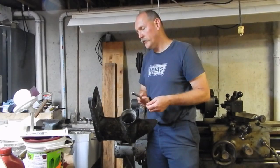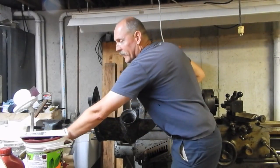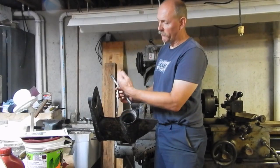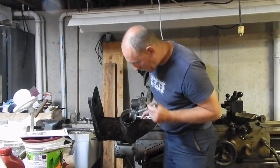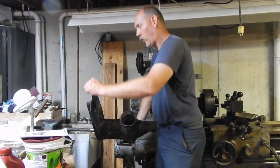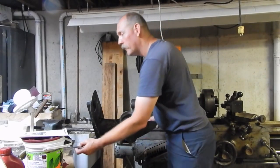This is the procedure he's used. I bolted the vise down securely, and I've got the shaft clamped in the vise there. Then he uses a box end wrench, and I was having trouble with the box end wrench slipping off. I think if I had a box end wrench that was straight instead of this curve, it would be okay. Because what happens is you put the wrench on, then you bring the body of the thing down to push on the wrench, and then twist the whole thing, because you get a lot of leverage twisting this. And it kept popping off. I think it's because it's not really lining up with the top here. It kind of wants to push it off.